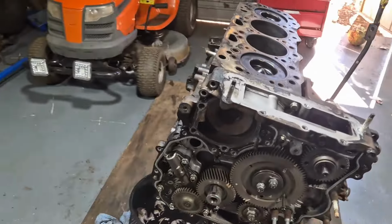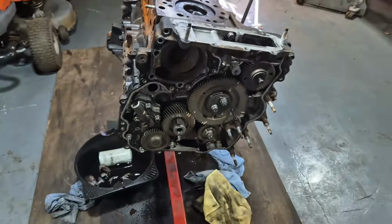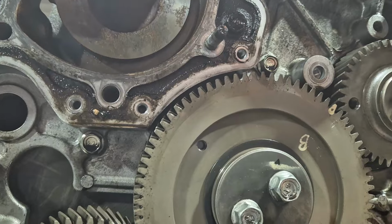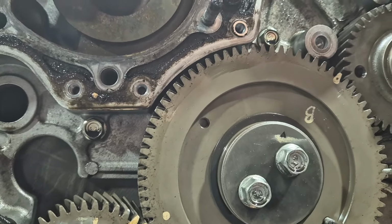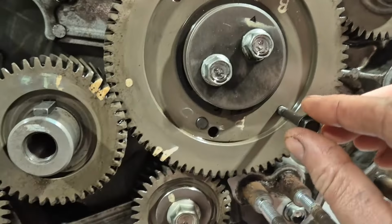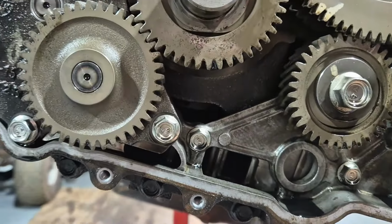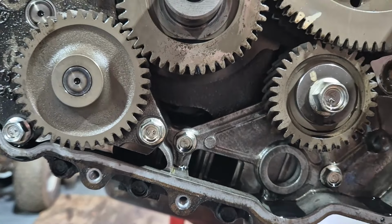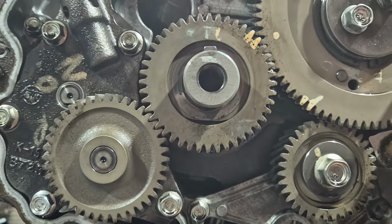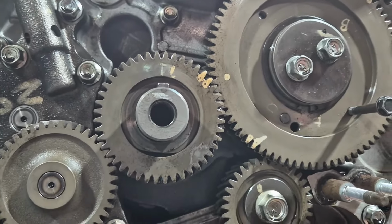Right now, I'm going to get these gears timed up. So I'm going to turn the engine over and time the gears up. This massive gear in the middle here is a scissor gear. So what I'm going to do, I've already done it, is put the bolt through there to lock the scissor gear. So that'll be all gravy, so that once I release, those teeth will be stuck together and we'll be laughing. So let's get this all turned around, have a look-ski.